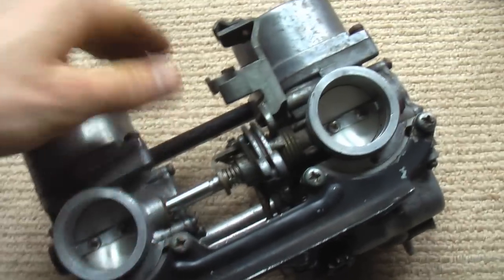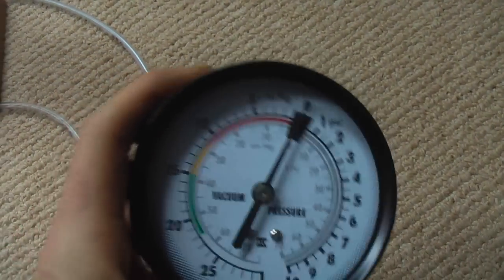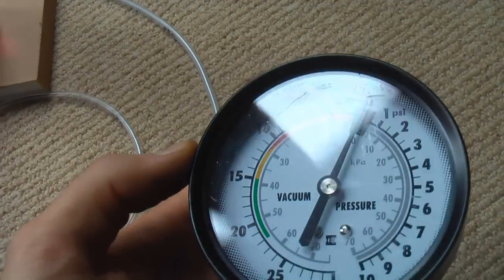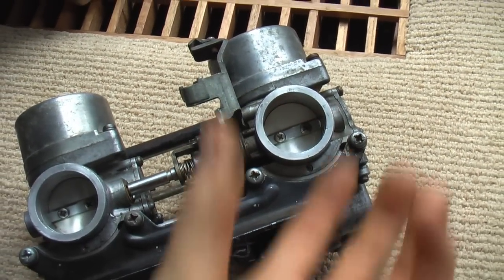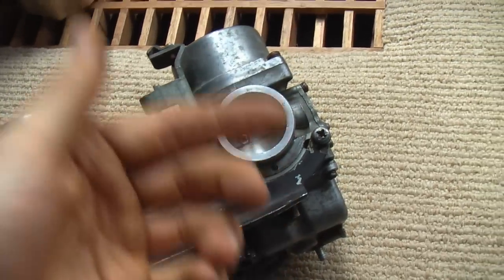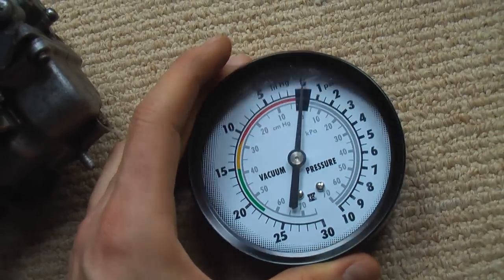There are various tools you can use for this — there are usually little screws right in front of the carbs on the engine that give you a passageway in, and you can connect up little gauges to get a pressure readout. You can buy these gauges and they give you an actual value readout, which is nice. But the thing I don't like about them is that they tend to jump around quite a bit at idle, because the cylinder sucks air through, then goes through a power stroke, then an exhaust stroke, then sucks more air through. So there's quite a bit of lag and the dial bounces back and forth, making it hard to get an accurate readout.